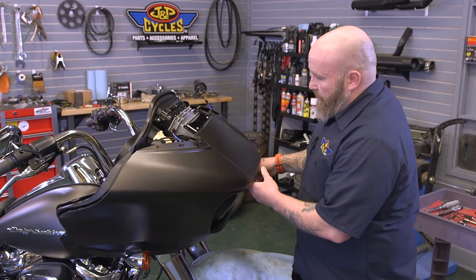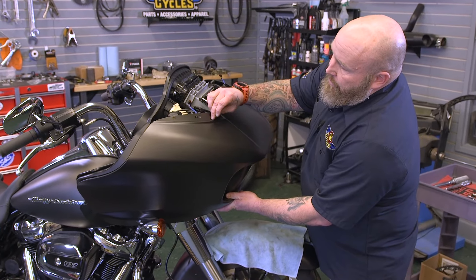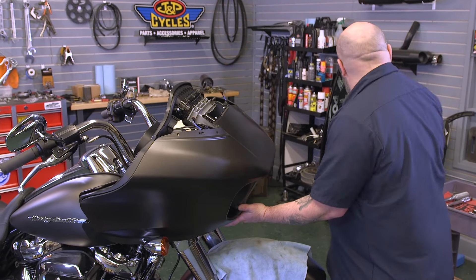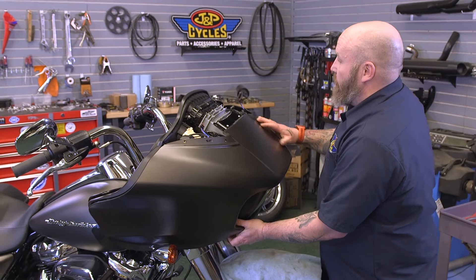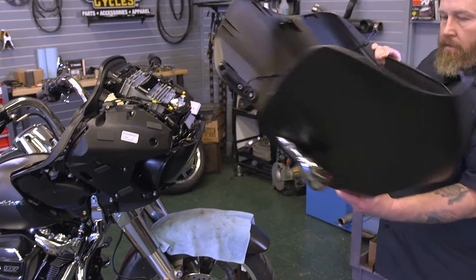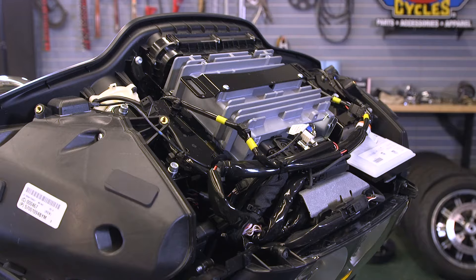You can see it's loose now. I'm going to put my hand on the front of it — the headlight is going to stay — and I'll pull the two windshield screws out without letting go of the outer fairing. Once we get those two out, this is going to come right off. A good thing to do is have a predetermined location for the fairing before you take it off, and obviously don't lay it paint side down. Otherwise it just pulls straight out and comes right down. Bob's your uncle — outer fairing is off. You're free to do any maintenance work or stereo upgrades.